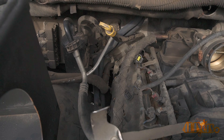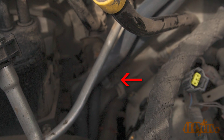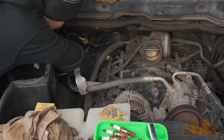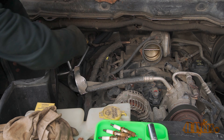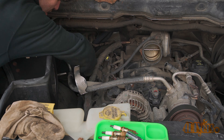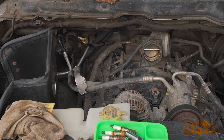Here's a view before those coil packs get reinstalled back onto the engine. You can see the heater core hose retaining clip at the rear on the firewall. Ensure the seals are clean around each of the spark plug boots and inspect the boots to ensure they are in good condition. Reinstall each of the coil packs and tighten the 10 millimeter bolts. Make sure the coil packs are seated properly in their mounting location. The torque specification for the coil packs on those 10 millimeter bolts is 62 inch-pounds — not to be confused with foot-pounds — or 7 newton meters. Then reconnect each of the electrical connectors; you'll know it's connected when you hear a click, and give it a pull test just to be safe.